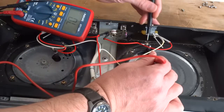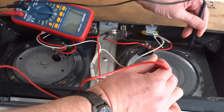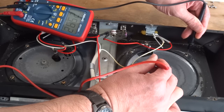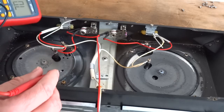I'll try this one. So 34 ohms, and got some current to earth but in the massive mega ohms range — so the elements are alright.